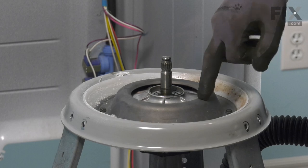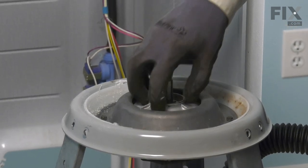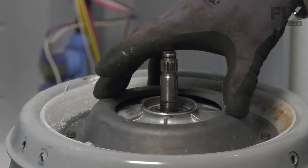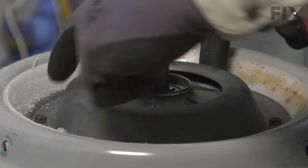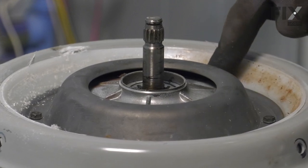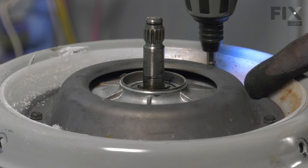Next step will be to remove that brake stator from that assembly. Now, there's a coil spring beneath that rotor that pushes the rotor against the brake stator. That's about a 200 pound pressure spring. So if you don't have the proper tool to remove that, we're simply going to take some longer screws and remove three of the existing screws, which are only about 3/4 of an inch long. So we'll get some screws with the same thread that are about 1.5 inches long. We'll begin by removing three of those.